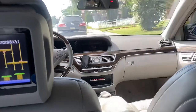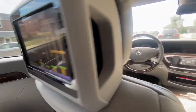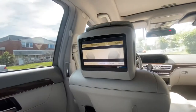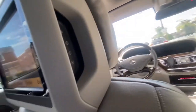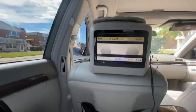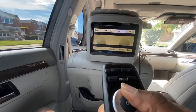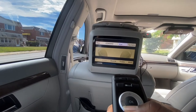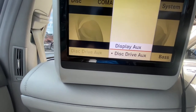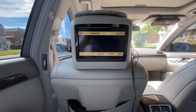There we go — we have the Nintendo menu on screen. Now we have Donkey Kong Jr. playing on this screen, a movie on the front screen, and the DVD player from the back on the other screen. Now let's show the side AUX jacks. Unplug from the floor player and plug the cables into the side of the screen instead. Come back to the remote, make sure the right screen is selected, and this time instead of AUX go to Source. You'll see two choices: Display AUX and Disc Drive AUX. Push up to Display AUX and press OK — and there we go.